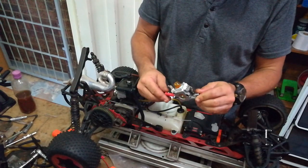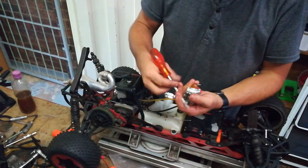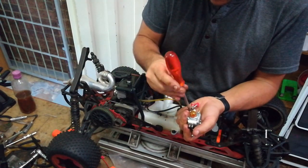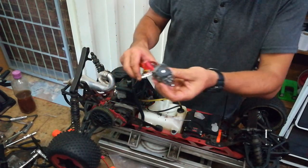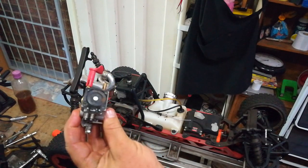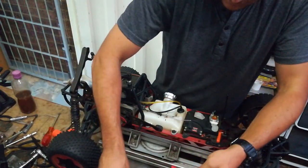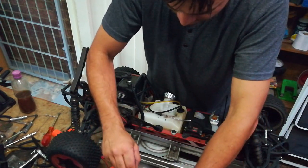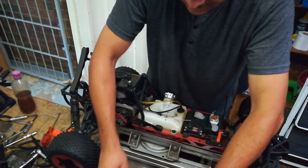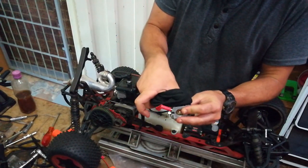Outside is pretty clean. Now what I'm going to do is take this top off and check the diaphragm. There's lots of gunk on top over there. I'm going to just wash that gunk off. Check this bottom here — this bottom actually looks quite clean. I just want to get some clean fuel from the top because the dirty stuff will obviously drop to the bottom of the container. Just clean that off and then get a clean piece of material and wipe it nice and clean.